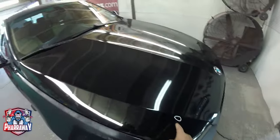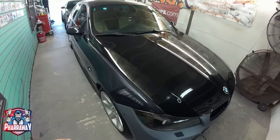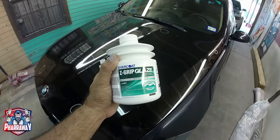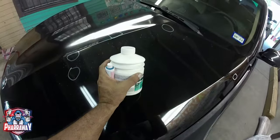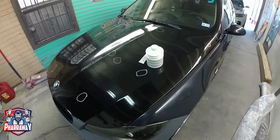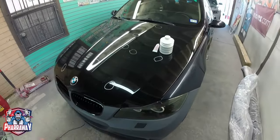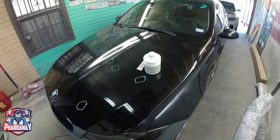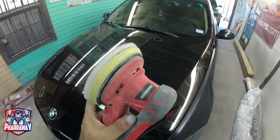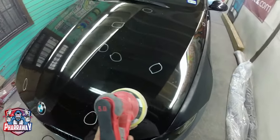I'm going to tackle the dents first — that's your first step. Tackle the dents before you start sanding because you will lose them once you start. The way I'm going to fix these dents is with this Grip Glaze. This is catalyzed, which needs hardener, so it's like body filler but a lot smoother and a lot thinner. Because these dents are not too deep, I don't need body filler. I'm going to take my DA with 220 grit sandpaper and rough up the area on all these little imperfections.